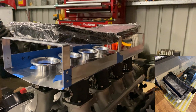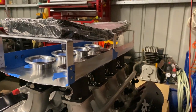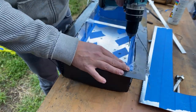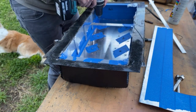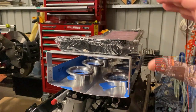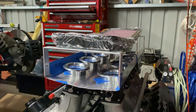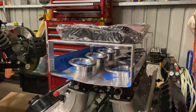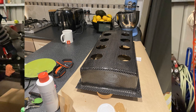Some of the terrible intakes you see — even some advertised with great horsepower figures — don't take heatsoak into consideration at all. If you're racing, it's great that you've got a 700 horsepower motor, but there's no point if it only actually produces 500 horsepower in normal conditions. There are lots of great dyno figures that don't produce horsepower consistently. The other thing is that with these cars, directing fresh air straight into the top of the motor will obviously give us an amazing sound — even at low RPM when you snap the throttle open, you'll hear it sucking air from the roof scoop directly next to your head.